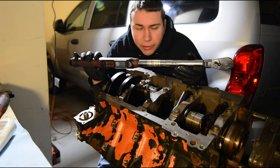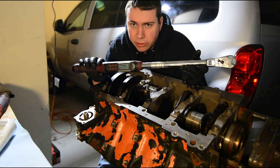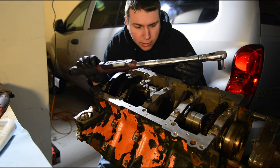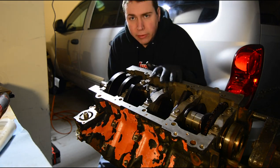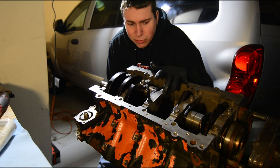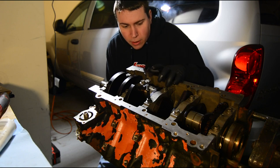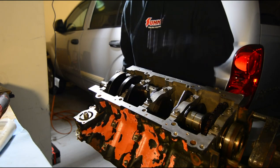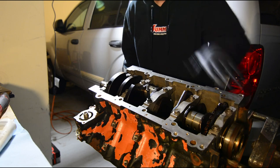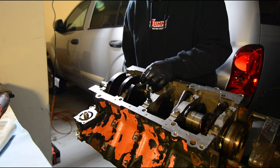I have a great electronic torque wrench that does torque as well as angle, so that will be useful. I also want to point out that these main caps on this Hemi engine also have bolts that come in from each side through the side of the block — those go on very last after these are all torqued down, but you don't want to forget them. The correct torquing pattern: you start with the center cap, then the fourth cap, second cap, fifth cap, and then the first cap. So I'm going to go ahead and do that, and then that is our crank installed.